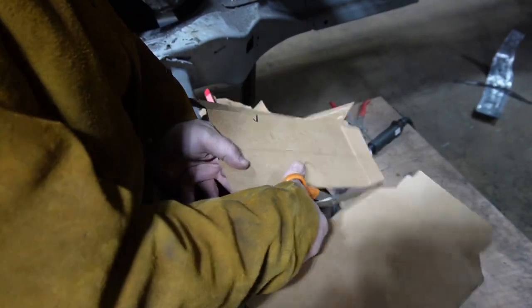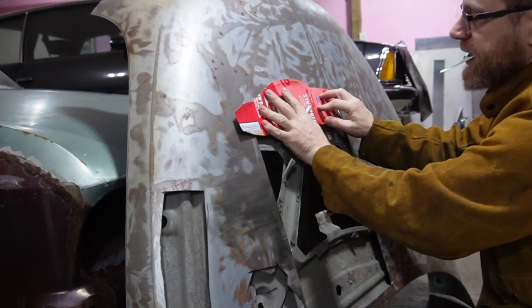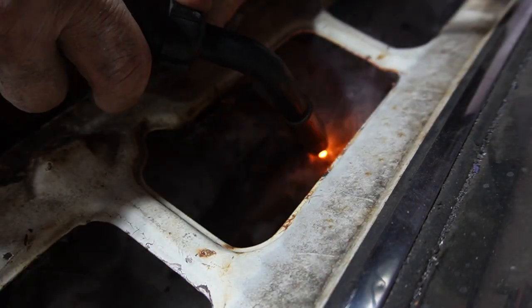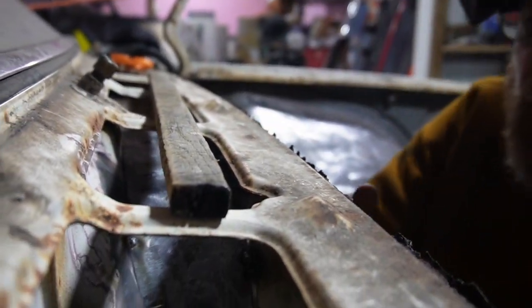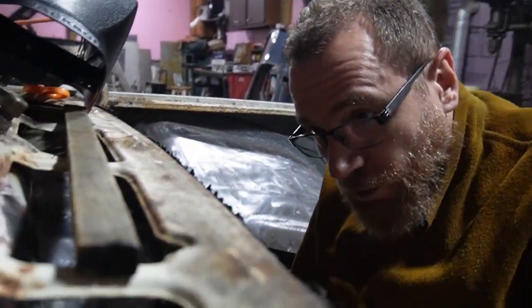The template we just created was too small, so we had to go back and redo it. This is probably going to be our best option to minimize waste. That will get us close enough that we can come in here with the grinder — I think the flap wheel — and we'll just start nibbling this back to the firewall until we've got a really close match, and we'll do just like we did on this piece and then just continue across.